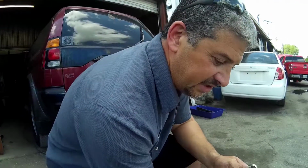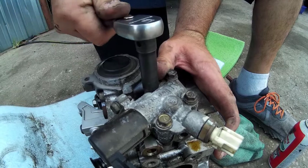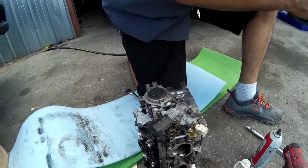But, I'll get off on a tangent. It drives me nuts when I watch people blast engine parts or tranny parts in with an electric or air impact gun. You don't know the torque you're putting on. So I always run it down until I hear it give that first click. I stop, then I always go back and manually tighten them down. These are small 10mm bolts going into an aluminum housing. It is so easy to snap one, to break the threads. Something so simple, if you mess up, it'll cost you hours of labor later on, and the customer ain't gonna pay for it.